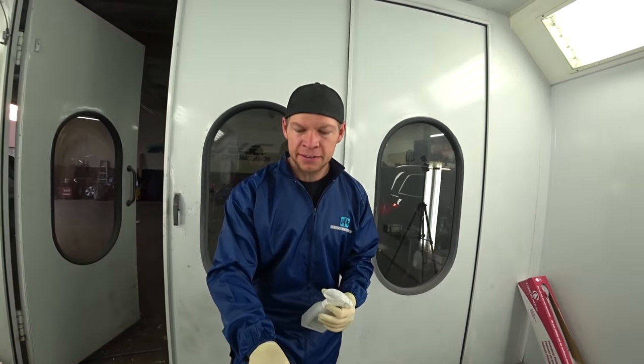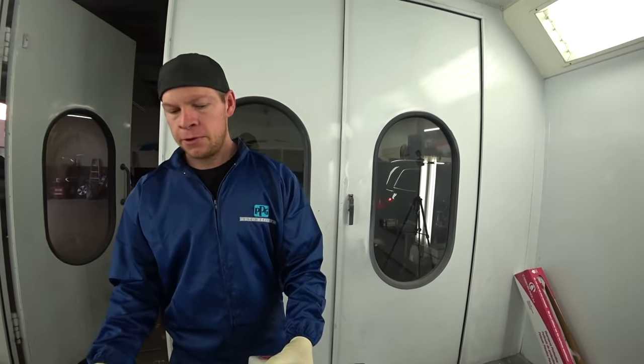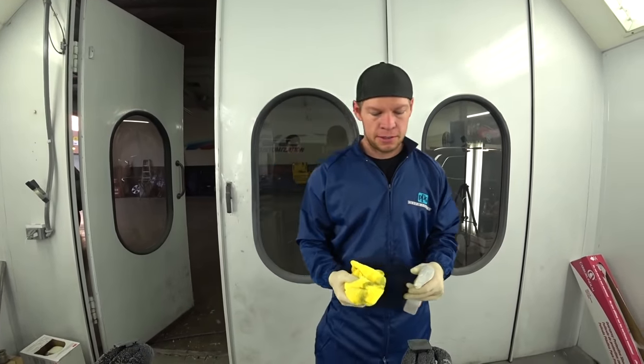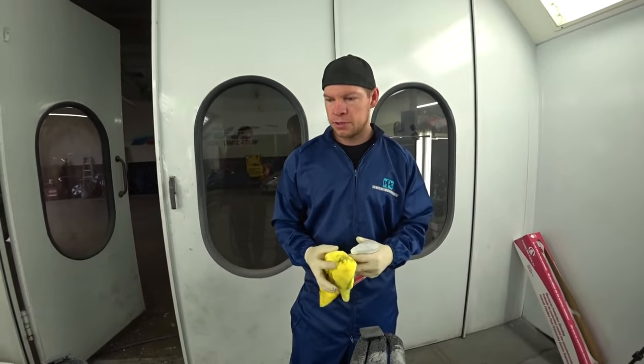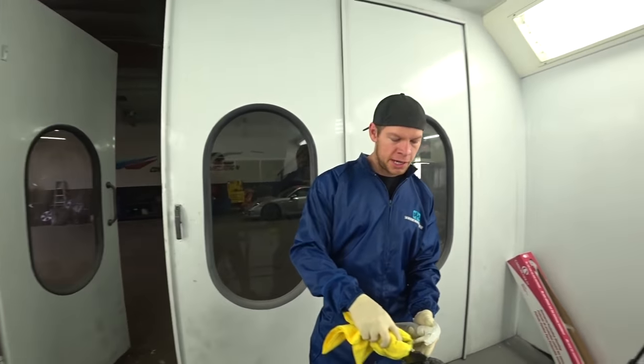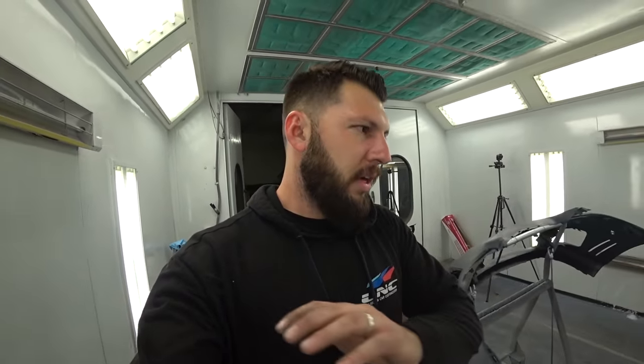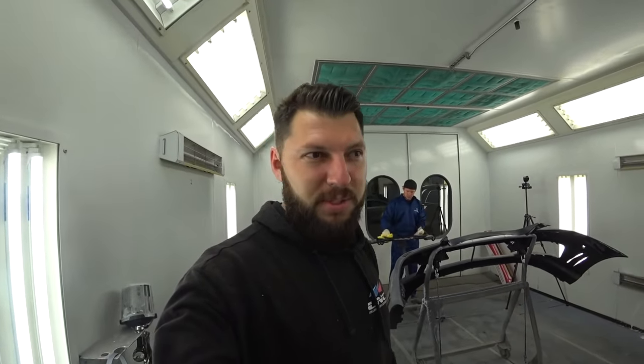These parts are plastic, so if you don't apply the sealer, in the long run it's gonna start peeling, as you see on some of the older cars. Then we'll base coat it and clear coat it. Should be good to go. The process you gotta go through, always put a sealer. First of all, you gotta prep real good and clean everything, and then throw some sealer, base paint, and then clear coat for the final.